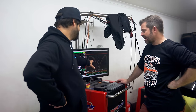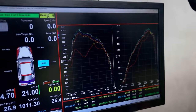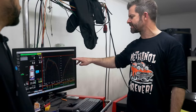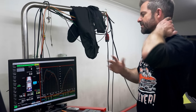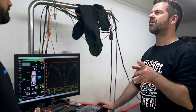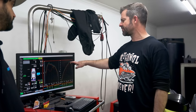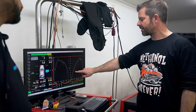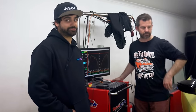It's literally like reversing that mountain of deadness into a mountain of goodness — it's literally 160 extra newton metres in that central part there. Peak power isn't hugely different up top; at 6,000 RPM it made 264 kilowatts completely stock. We did six or seven runs in fourth and fifth and it was within 2-4 kilowatts each time. We made as much as about 295, but because of the heat exchanger and the stock exhaust we wound it back a bit, ending up with about 282 kilowatts — so about a 25-26 kilowatt gain up top, but in certain spots around 3,000-3,500 RPM it picks up nearly 80 kilowatts at the wheels. It feels completely different — makes the car how it should be.